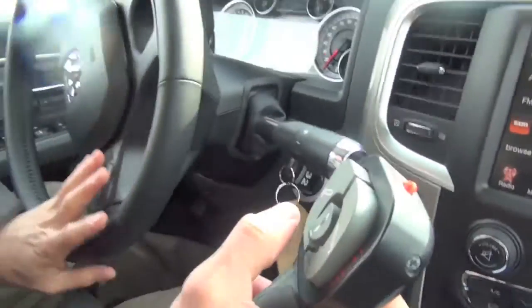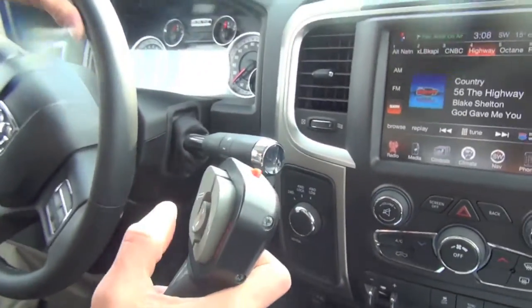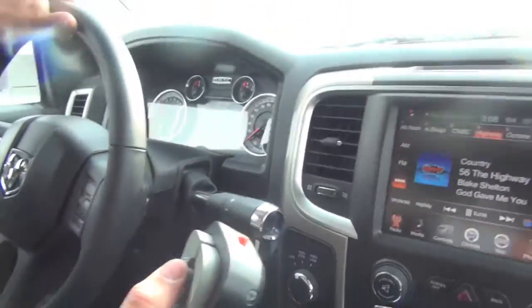Let's line up for another pass. You can still do it in circles if you wanted to — we'll come back and do a crescent shape. Go ahead and straighten yourself out towards this line. Back up so you can get running at it. Now you can see this area is a little deeper, so what you're probably going to do here is get a little momentum and then drop the blade into plow mode. I did a pretty good job. You did — that's a straight shot, a really clean cut. Is there a way to put it straight in one shot? You just have to take a look at it and figure out the horizon of the hood of the truck.